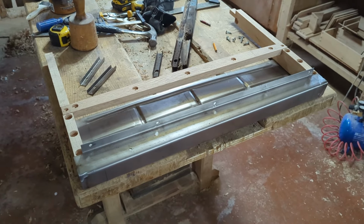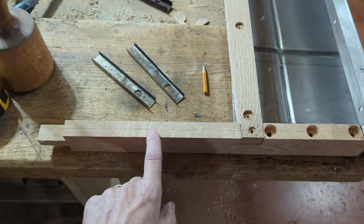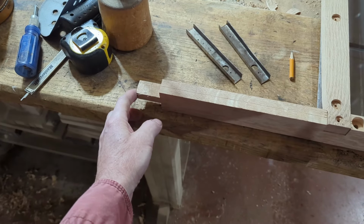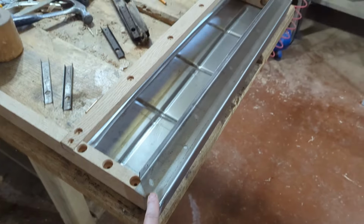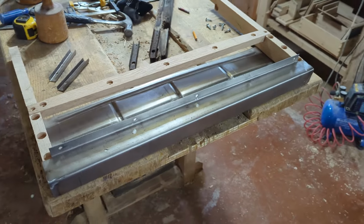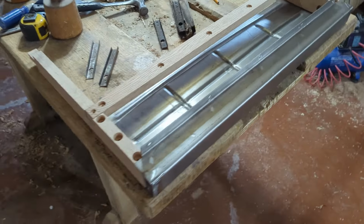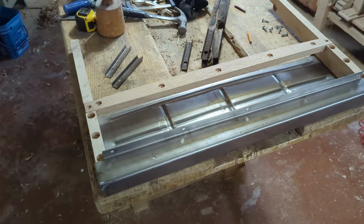So before I put the rear window wood in, I did a dry fit on it. I took these pieces here that I made from the original pieces. Like I said, I made up a couple blanks from the last time I did the 5 window. Cut these tenons up, so I've already dry fitted that out in the car. Just dry fitting this piece and then actually dry fitting it into the metal drip tray that I also made in a previous episode. Not going to go through how I made this one, but we'll try and put a link at the end of the video to show you how I made the drip trays for the back of the 5 window. So right now this is basically at the stage where I'm going to put a clear coat of urethane on it, get it ready to go and get installed in the car.